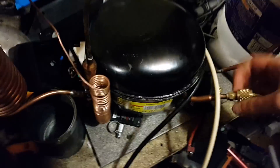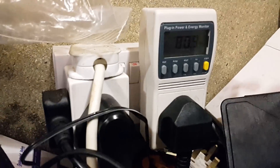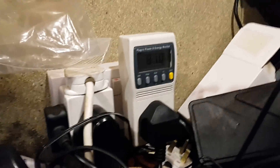Got all that refrigerant purged out. I've vacuumed it out as much as I can, so I'll probably have a tiny bit of refrigerant left, but it's consuming 81 watts currently and it's not freezing up anymore. I just need to purge this short length of hose - you know it's purged because you'll see shimmering coming from the end. I'm going to add the propane as vapor and just watch the power consumption.